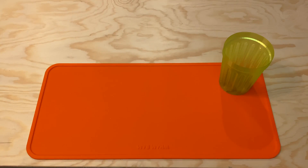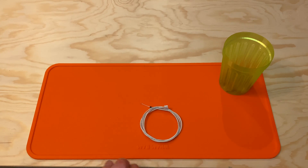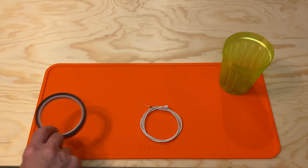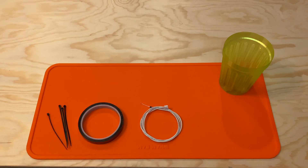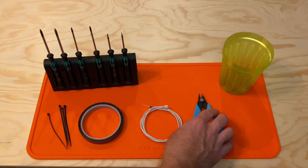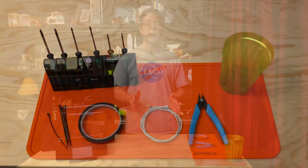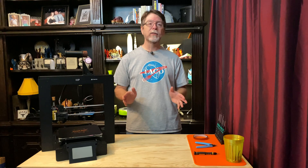Now, there are a few things that we're going to need before we start taking things apart. First and most obviously, we need a replacement thermistor with a cable. I'm using this one, which includes a 1 meter cable and the appropriate connector already on the end of it. We'll also need some Kapton tape, and we'll need some zip ties. And we'll need some tools to get inside the printer. The hex keys which came with the printer will do just fine. I've got a nice set of ball-end hex drivers, so I'll use these. I still keep the Monoprice supplied hex keys around for times when I need a little extra torque to loosen one of the screws. Also, flush cutters are useful for snipping zip ties. So: new thermistor, Kapton tape, and tools. If you need any of these things, there are links in the description.